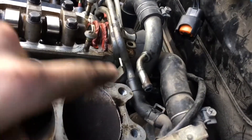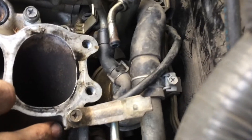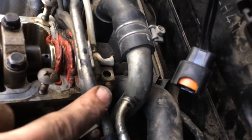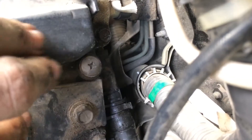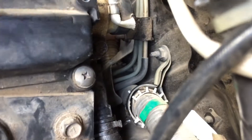I've been fighting with this hard line here that has the coolant. The annoying part isn't the coolant — it's the PCV that comes all the way around and blocks off the studs to remove the lower intake. It turns out there's a bolt I was missing: one on top of there, and one directly under my finger that holds it to the head — you honestly can't even see it. I wouldn't have found it if I hadn't seen a picture of it removed.